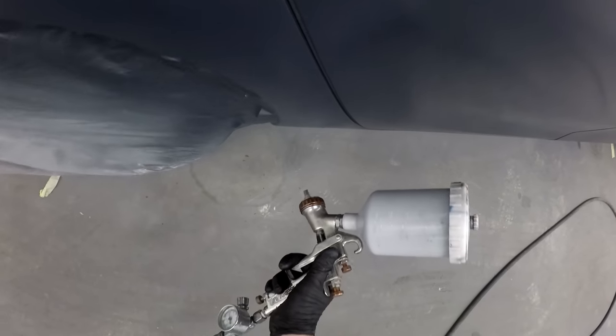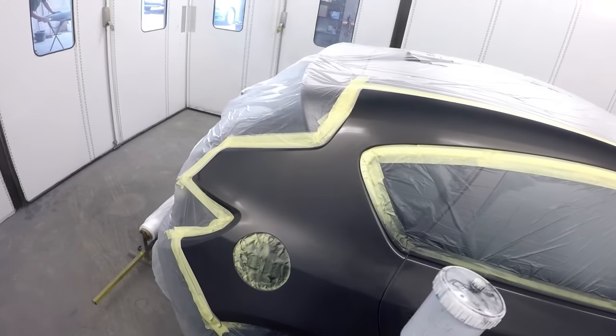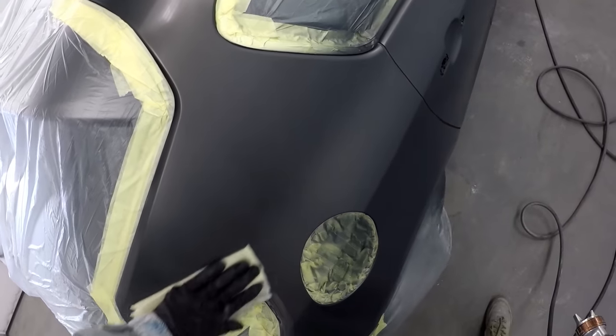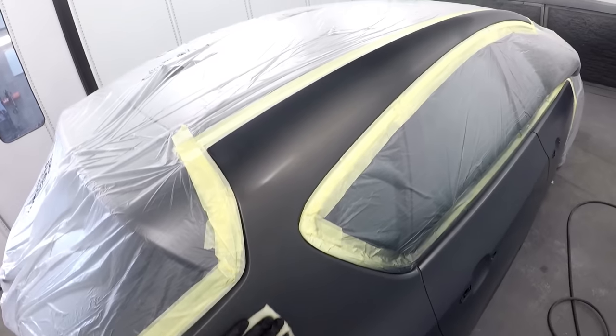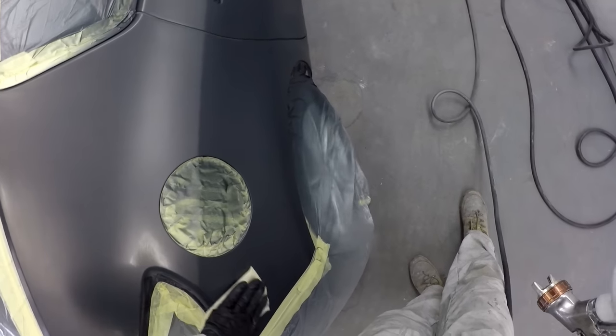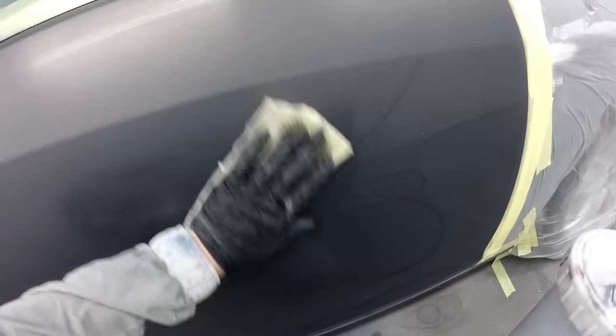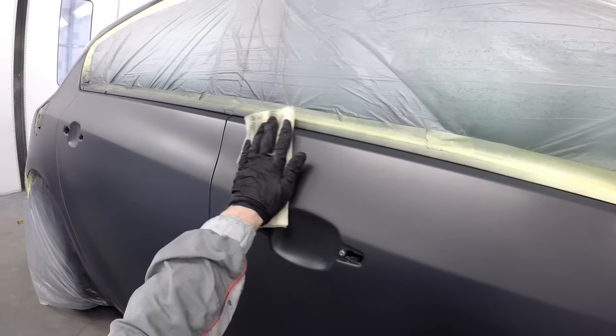I painted this colour twice and it was an absolute pain to blend out. Whenever I blended this colour it did leave quite a mottled, really uneven finish — and there's not many colours at all that I struggle with to blend, but this was definitely one of them. It was only a trade job, but even though it's a trade job it's still a new car so I want to make sure it's right. On a private job I prefer to do a full clear on a panel, and really on a trade job as well, but this isn't my shop so I do what the boss wants.